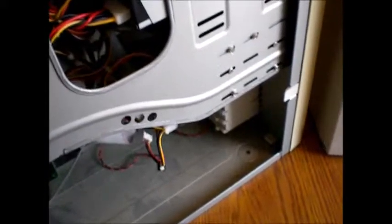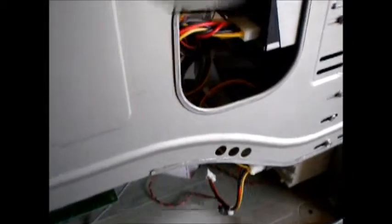Inside the machine actually looks quite clean. You can see the two old Western Digital drives - no real dust to speak of. That's the first machine. The CPU fan bearing is going out badly - it sounds like a grind fest, not very healthy. I don't have another 40mm fan to put on there. Let's move on to the second system.